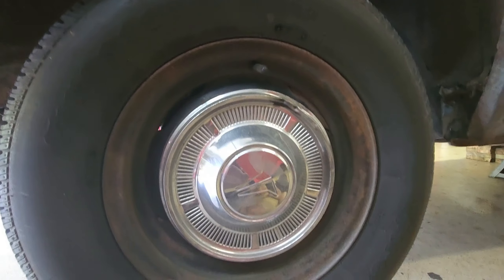Traction isn't as important to me as drivability, but I also want the car to look the part. For this car in particular, it's more important that it looks like a gasser. If you tub the whole thing out and put 30-inch tall, 12-inch wide slicks underneath it, you lose the nostalgic look I'm going for. If I put a nine-inch wide slick on the back, the car's going to hook just fine and still look pretty sweet.